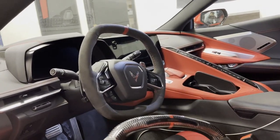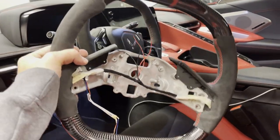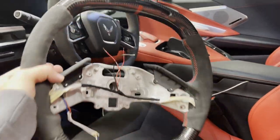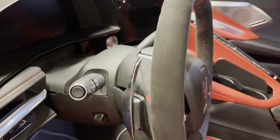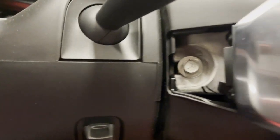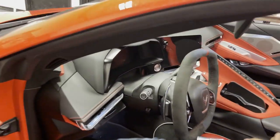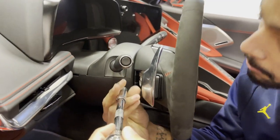Here's a little comparison between the two — it's about to look dope, been wanting these for a while. We're going to take off this old steering wheel and swap over all the buttons and controls onto the new one. To get the steering wheel off, it's actually much easier than the Camaro steering wheels. You move this back little plastic piece right here — it comes right off, then exit the bolt on each side and take off the 10 millimeter bolts.